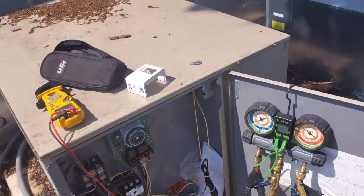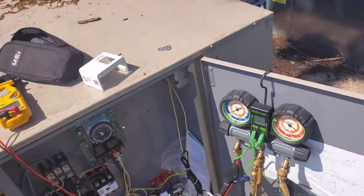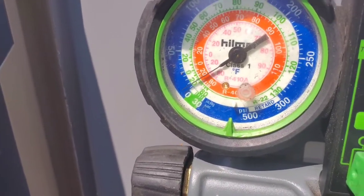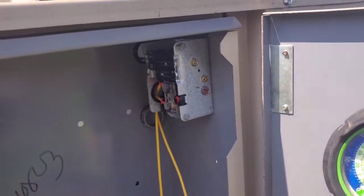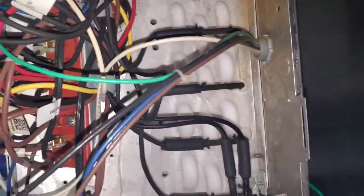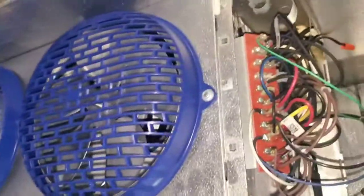The reason the fans wouldn't come on is because the compressor was cycling off on low pressure. That's where the pressure's at right now. Adjusted the pressure switch — stopped cutting out at 15 psi. Still haven't turned the fans back on yet, but see how the ice is getting closer to the thermostat? Now it actually will terminate. Apparently that's the reason it was frosting.